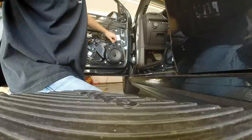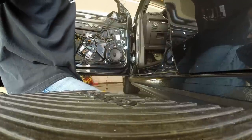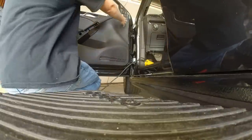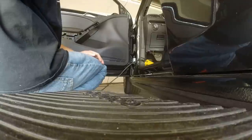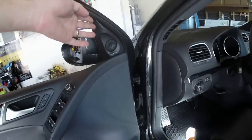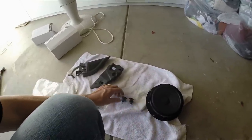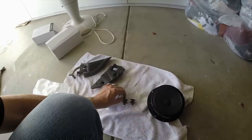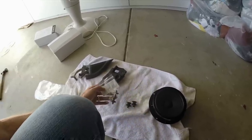Finally you snap your plug back in to get the car back together. You hang your door into a little ridge at the top, then you've got three and three — inside and out. Pop, pop, pop. Pop, pop, pop. Now we do our four screws and we're pretty much done. That's the Focal install. I'm going to get through the other side a lot quicker. The first side took me a good hour; the second side took me maybe fifteen minutes. So once you learn it, it's real good. I did actually break a couple clips — well, they're supposed to be wide like that. One on each door, so I used two of the four they supplied. Killer touch or I would have been screwed.